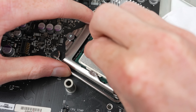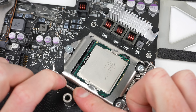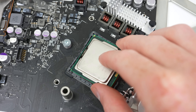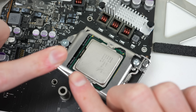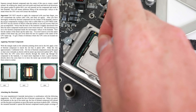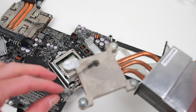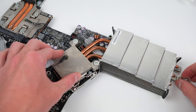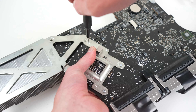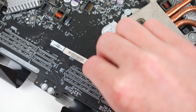It's now time to remove the Intel Core i5-2400S. I'll wipe off the thermal paste prior to removing it, just so I don't make a mess. After unleashing the lever, the old CPU can be removed and replaced with the Core i7. I'll now apply some thermal paste as outlined in the official guide. All that we need to do to complete this CPU upgrade is to reattach the heatsink. I will loosely attach all screws before tightening them down — this is to prevent uneven pressure on the CPU, which could cause damage.